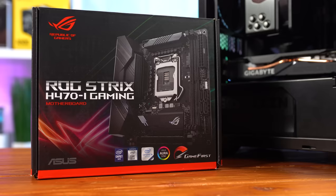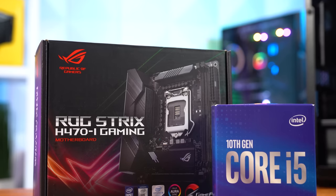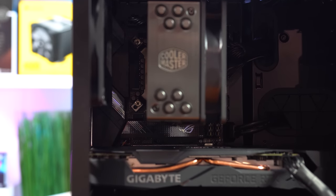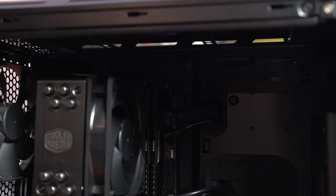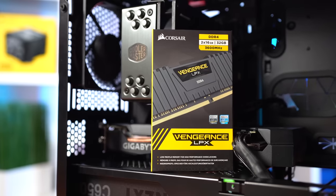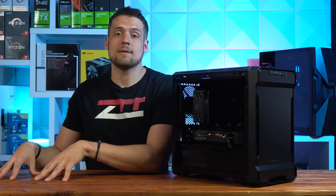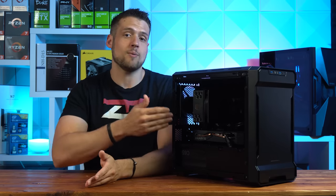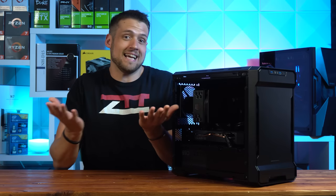Speaking of the ITX motherboard, this is the ASUS ROG Strix H470 ITX — an absolute beauty. There's no need to go with a Z motherboard with the 10400 since you can't overclock the CPU, so you save a bit of money there. The Strix H470 has an all-black design, enough IO ports, built-in WiFi with an impressive antenna, and two RAM slots. Corsair sent out this 2x16GB kit of their Black Vengeance LPX series clocked at 3600MHz. The official max supported RAM speed of the 10400 is only 2666MHz with a B or H motherboard, so you don't need to spend the extra money on a 3600MHz kit.